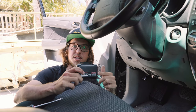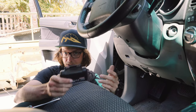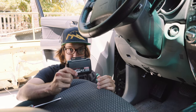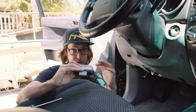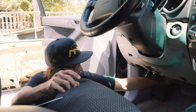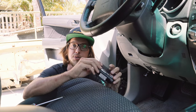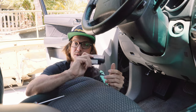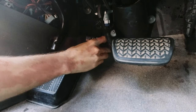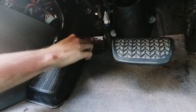Now let's head inside. One of the cool things about the TowPro is that it works essentially off of an accelerometer — it's part of what makes the auto mode so good, and it also allows it to be mounted any which way, as long as it's mounted somewhere solid, preferably to metal. We've looked everywhere in this 4Runner and the best place we could find is right down here, out of the way of the pedals, screwing through the carpet into the firewall. With four screws, that should be a super solid connection. With this parking brake cable to consider, we'll be putting the TowPro upside down to help accommodate all the wiring and make sure everything clears nicely all the way around.